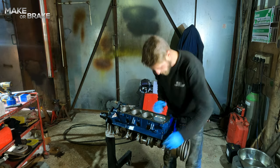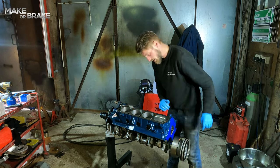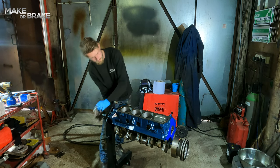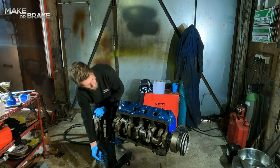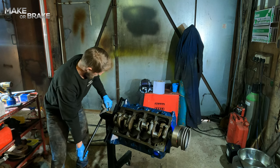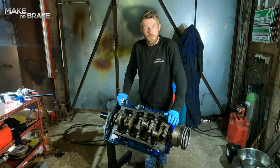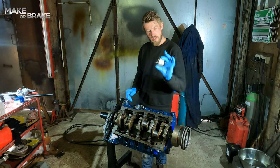You only want it flush for the time being, you don't want the bottom of your connecting rod to be hitting anywhere. You notice that I've got the crank turned in such a way that it's as far away from that bore. So, once you've got a piston in, it's time to pay a little bit of attention to your big end